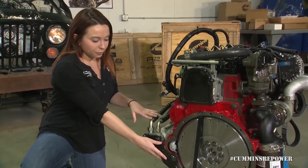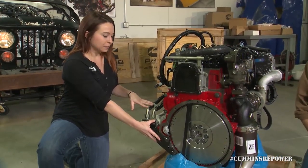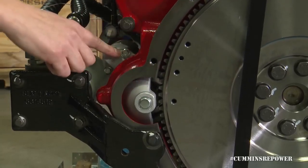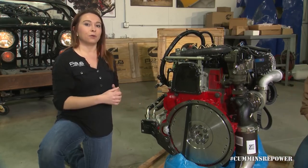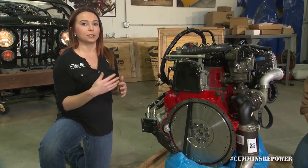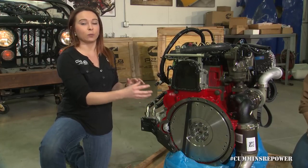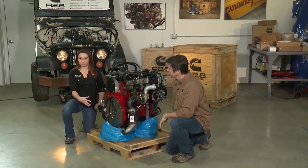You're going to have removed this bracket for your oil filter — that'll be out of the way mounted on the chassis — and you'll want to take into consideration your starter, which is mounted on your flywheel housing and interacts directly with your flywheel. Definitely look for a SEMA member who has engineered transmission adapters and flywheel adaptation that will take all this into account and will reduce overhung mass on your flywheel and crankshaft to reduce any potential for failure.